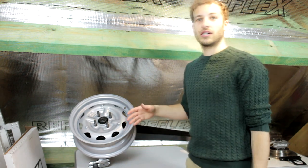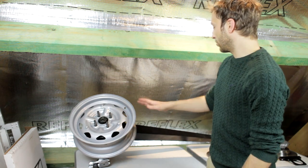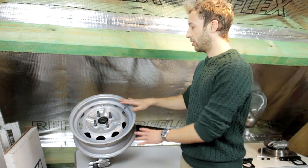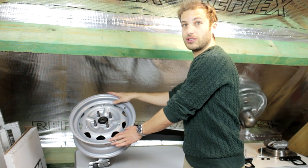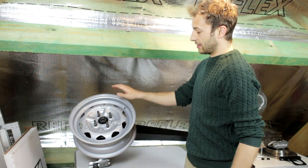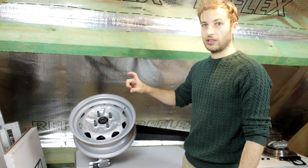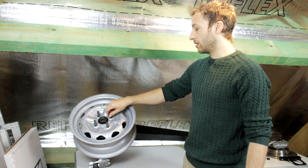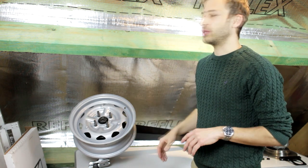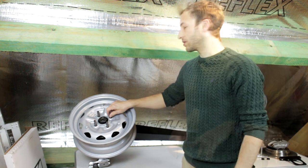What you can see here is essentially a rear suspension corner. This is the radius arm with the hub, the drive shaft, the lower link all attached. I have an original wheel mounted. The only thing that's not original on this setup is I have changed the wheel studs to M12 and 60mm long. They're very long just to be able to mount some different types of wheels, and they're a little bit stronger than the original small wheel studs.